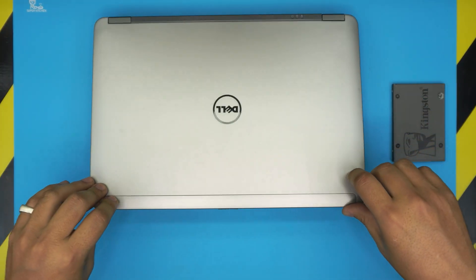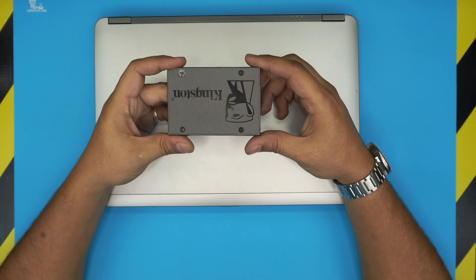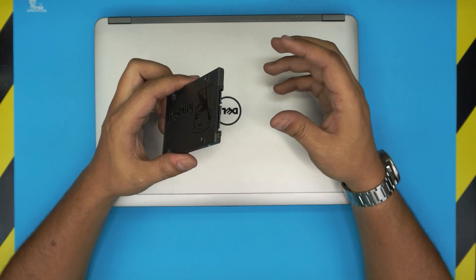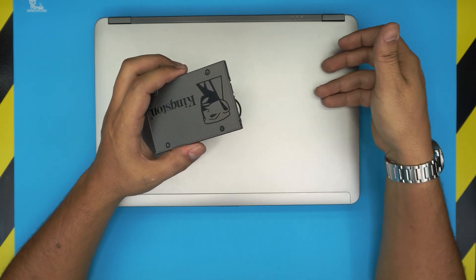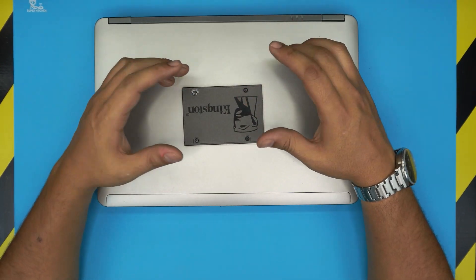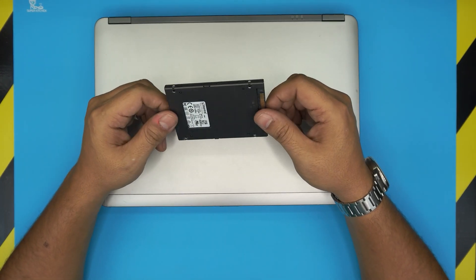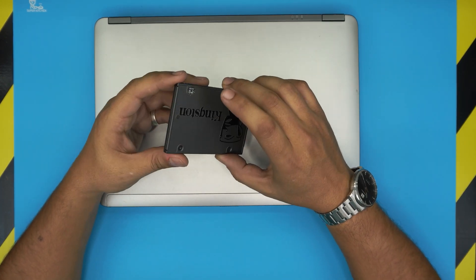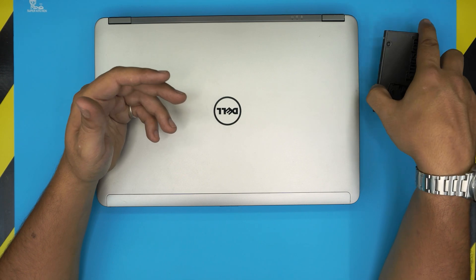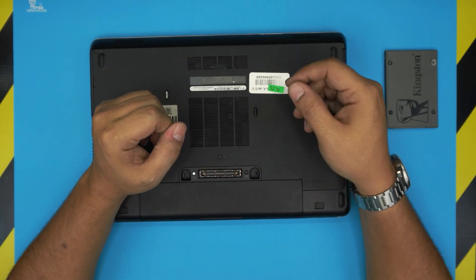What you want to do is swap the hard drives. I highly recommend doing a fresh install of Windows when you swap from a mechanical drive to a solid state drive. You can clone from mechanical to SSD, but it's not recommended because the file architecture on a solid state drive is much different than a mechanical drive. Once you have the drive in, it's easy to install the OS — I made a video on how to burn a Windows image to a USB drive and boot it up, link in the description.